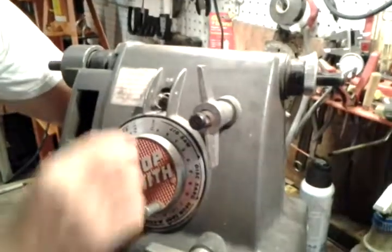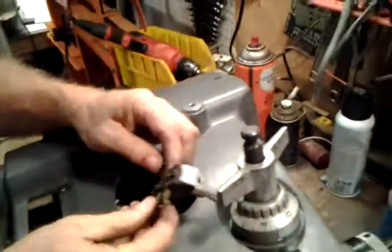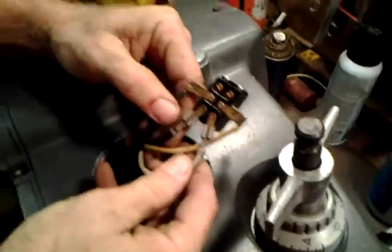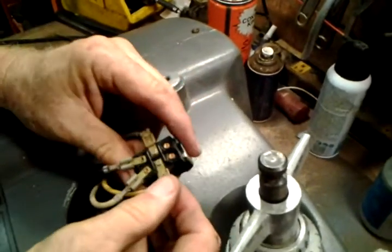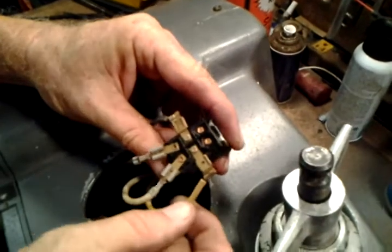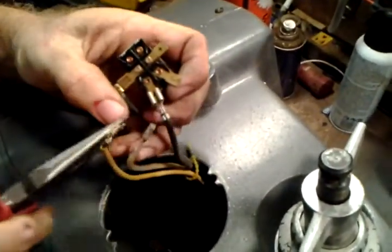Some of the switches may have a small nut too. In that case, you could use just pliers to loosen the nut. Now I'm going to push the switch in and pull it out through the inspection port hole. Keep the serrated washer. There are four contacts — two of them light colored, two of them dark colored. The colors change over time. These switches often get loose terminals where they swing and can short out against each other. Inspect your wires to make sure you don't have little strays sticking out. We'll disconnect all four of these leads and reconnect them the same way.